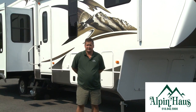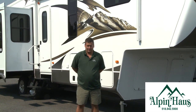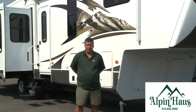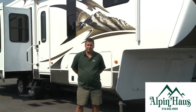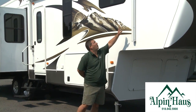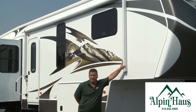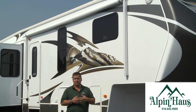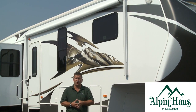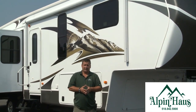If you're out camping and you have the misfortune of the awning not retracting back in when camping is over, it's okay — there are still a couple of things we can do. If the switch fails and the awning will not retract, the electric motor is inside this front arm. There is a male and female plug that will need to get unplugged. You simply need to apply a 12-volt power supply to the plug itself and that will override the switch.